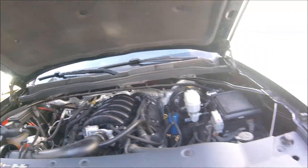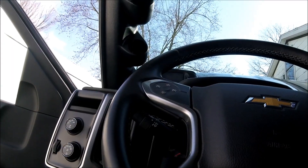We're going to do a throttle body relearn. Basically, if you don't know what that is — you have to start the truck and let it run at idle for three minutes in park, then shut it off for 60 seconds, turn it back on and let it idle for three more minutes in park. If any codes show up, clear them so the ECM can continue to learn. Let's see what happens — moment of truth.